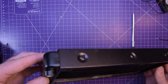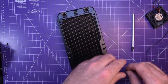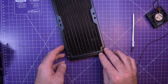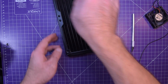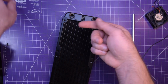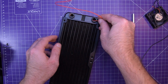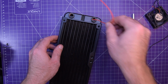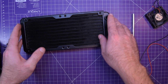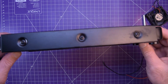But so yeah, this is for water cooling, and I'm just looking, and it looks like it's supposed to come in here, flow through, come down this tank, and then flow up and then out. But we just got to make sure that there's actually a wall in the middle there. Because if there's no wall here, that means coolant will just flow randomly. Okay, there is a wall there. So yeah, so that means I have to figure out what kind of fittings I need now. Usually they're the British standard fittings.